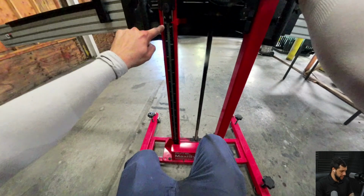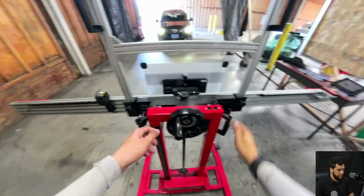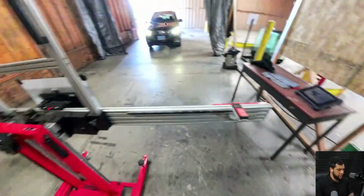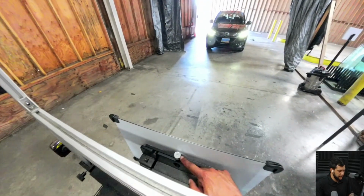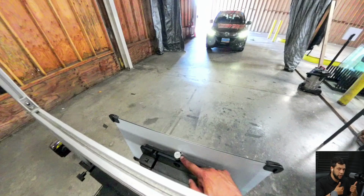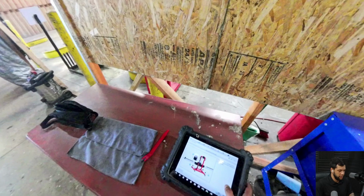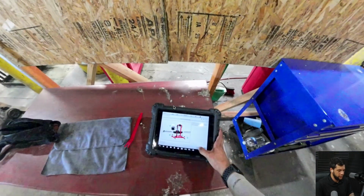All right, so here it is at the right place, pointing on the A side, which is this side right here, 950. You guys cannot see, but believe me, it's 950. So, all right, everything is good. And now what I need to do is to adjust this bubble level in order for the bubble to be right in the middle and the frame is set to the good level, okay? Oh, looks like it was good already, so perfect. Couldn't see. So I hit it, okay.